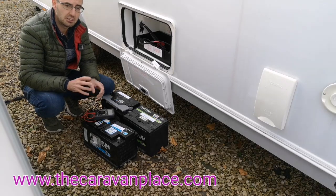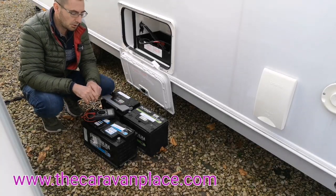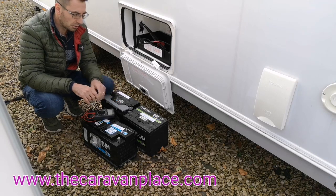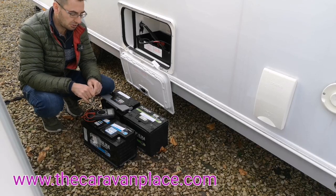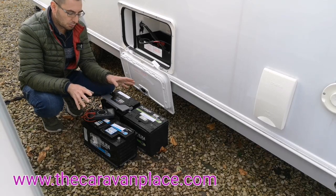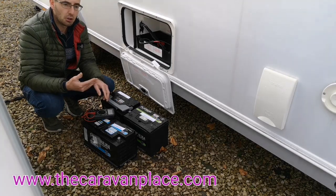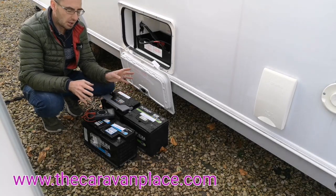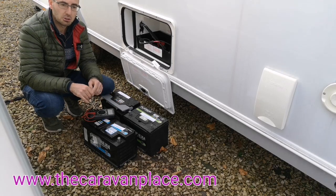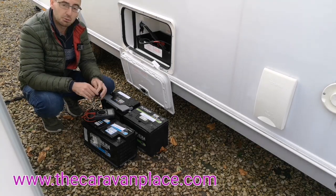When you look at it and say that £200 was better spent than £70 or £80 on a lower quality battery — but again, it's horses for courses. Regardless of what battery you go for, it's got to be charged up and that is going to prolong its life. Through the winter, the harsh conditions and not using it more means it's going to reduce the quality of that battery quicker. So it's more important to make sure the battery is taken off, fully charged up, fully cycled, and then returned.